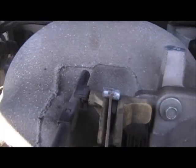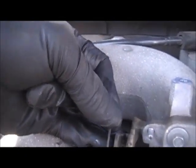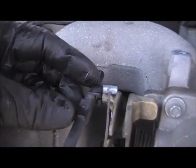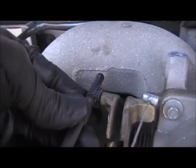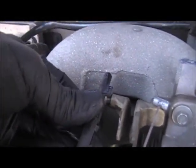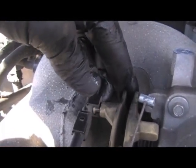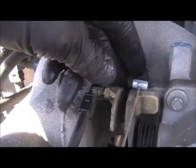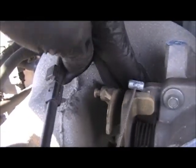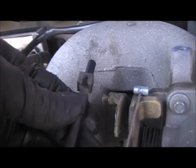This one cable right here seems to get broken more than any other. You'll be able to simply slide it out of the groove when you pull the throttle around — it's self-explanatory. All you have to do is push it forward and it slides right out. To put it back on, you simply snap it back. It's slotted — it slides in and that's it. A lot of people try to pop it with a screwdriver, but don't do that. Don't break it.